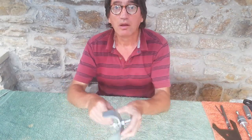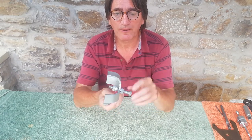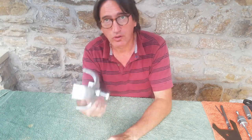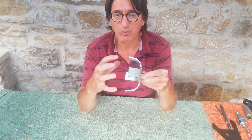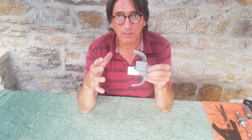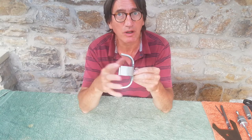Starting with this one — on any Commando you need this: it's a clutch removal tool. What it does is release the tension on the clutch diaphragm spring. It's a very simple, agricultural tool and completely and utterly essential. Do not try to dismantle your clutch without one of these. It clamps up on the compressed spring, flattening it and taking the pressure off, so you can undo the circlip and pull it off. Without this, that clutch is going to let go at around five thousand pounds pressure and do an awful lot of damage.